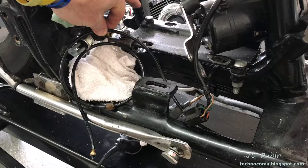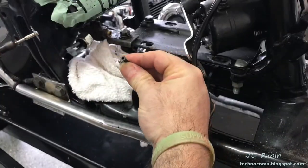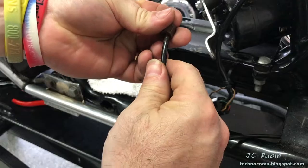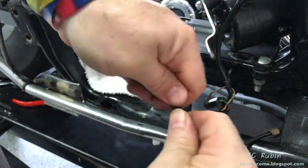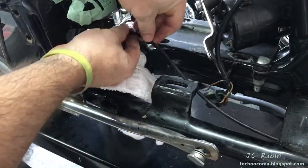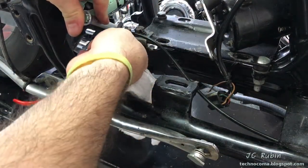I'm measuring the new length. I don't want to use a pair of snips because it'll get deformed when you cut, so I'm using a cutting wheel. Here's that small fitting removed from the old length of hose. I'll drop everything back onto the brake line, get this fitting on, connect it right back up, hand tighten it, and then lock it back down with the wrenches.